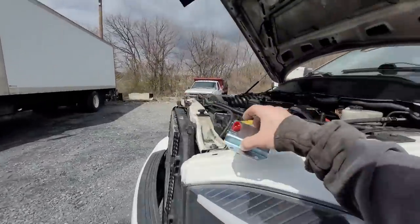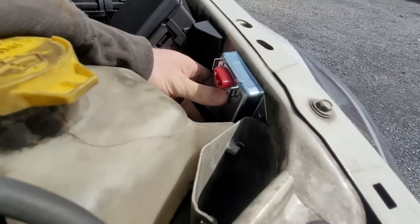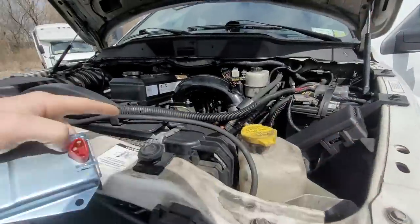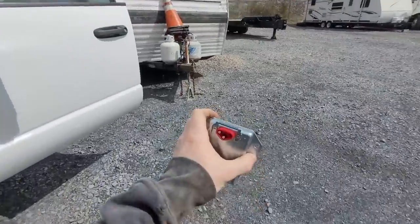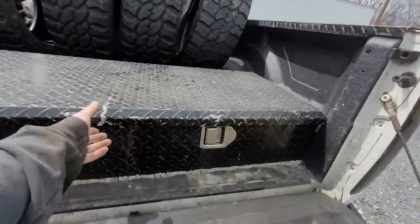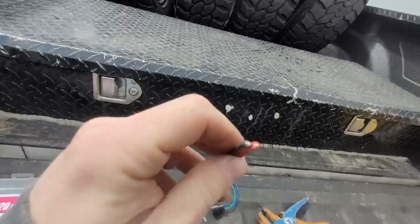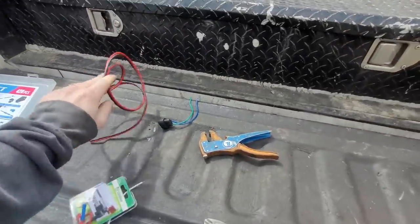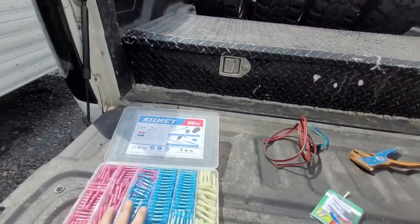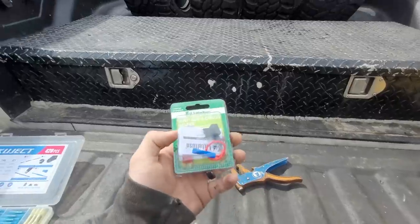We're going to try to make this look a lot nicer than factory and make it simple for him, because he's got work for the truck but he can't use it the way it is. We're going to tee right in here with a splice and run two little wires along to his alternator — nice and clean, it'll look factory. We have a ton of loom and 12-gauge wire. I made sure to grab an entire spool. So we're going to loom it up, make it look good, get this guy installed, figure out how big we need to make it, and go from there.